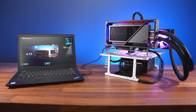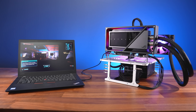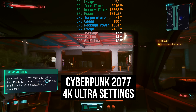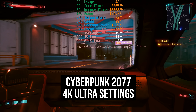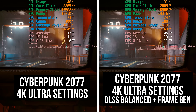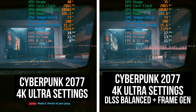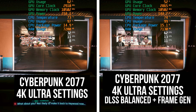This takes the laptop from not being able to run games at all on its integrated graphics, to playing modern games at 4K max settings. But there's a serious problem — just check out the stuttering in Cyberpunk 2077. Even at 4K, which is a super GPU-heavy workload, the RTX 4090 is hardly getting used because the dual-core CPU is at its limit. Turning on features like DLSS super resolution and frame generation helps — the CPU is still the limit and it's a bit choppy, but gameplay is definitely smoother and less jarring, so the game is kind of playable.